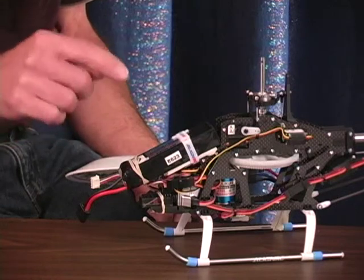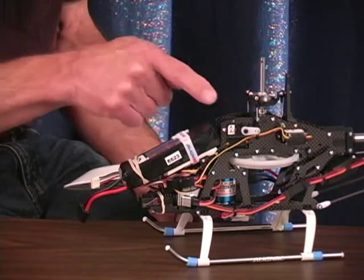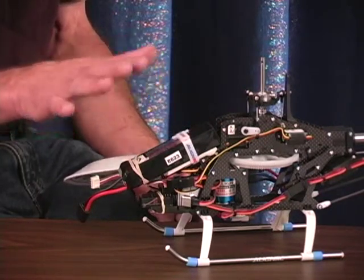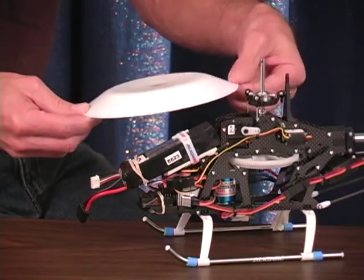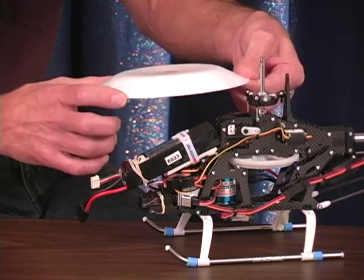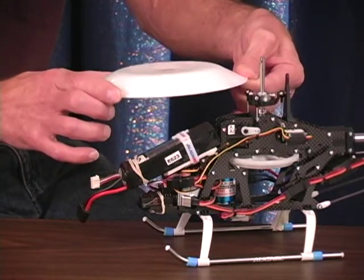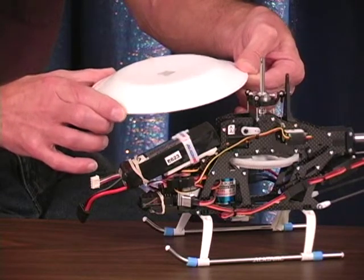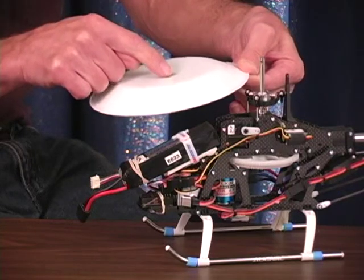In the next shot, you're going to see me talk about splitting the difference between the aileron servo and the pitch servo. And I just want to clarify the reason that I do it this way. Here's a swash plate using a dinner plate. Here's the elevator pickoff, the aileron pickoff, and the pitch pickoff. Let's say we're talking about roll. If I just make a roll correction by taking the aileron servo and pulling it down, that is actually taking out just a touch of collective pitch.